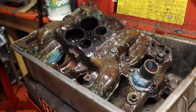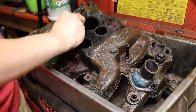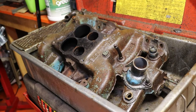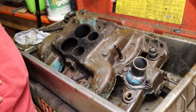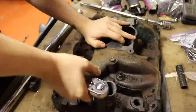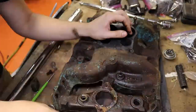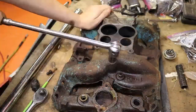We're going to start the intake cleaning process by actually getting it clean and degreased. We're going to start with basic Simple Green, a wire brush, and just some roughness to it. We went and hit it with some brake clean and xylene as well in the parts cleaner — it just makes things a little easier. The brush just knocks things off. Once that's done, we can kind of strip it down. It's just easier sometimes to clean it before you actually start taking things apart.